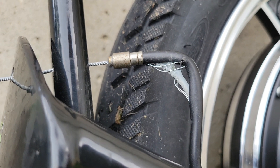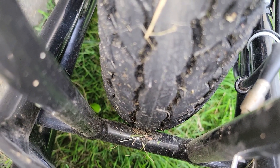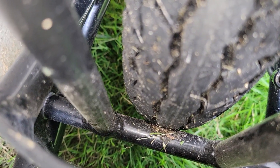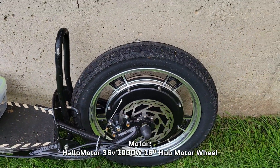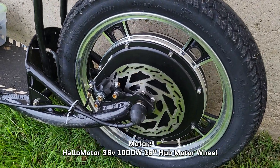I just have to repair the brake line first. I'm not sure I want to keep the physical brakes, knowing that I have working regen brakes, because the crossbar for the brake lever on the back is actually rubbing up against the rear tire, since the tire on the eBike hub motor is a lot larger than the original tire. The motor itself is a 36 volt, 1000 watt Halo Motors 16 inch eBike hub motor kit, although in my speed controller I do have it pegged at only 900 watts for now.